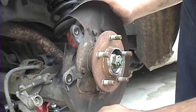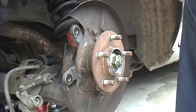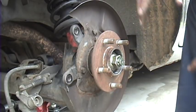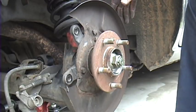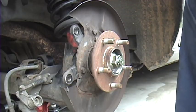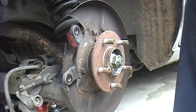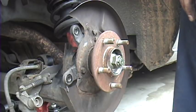It's a good time to check out your backing plate also. These are kind of rusted — this one ain't too bad, but the other side ripped completely off. Now's a good time to look at your exhaust on this wheel, check out your rear struts to see if they're leaking, and see if the dust boots and bumpers are all torn up, because they likely will be. Check your parking brake cables and make sure they're not seized up.